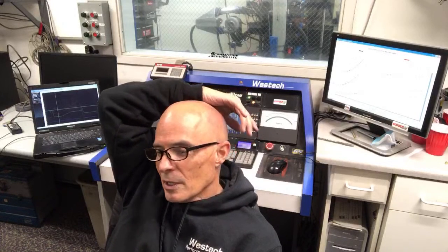What's the best place for water injection spot if there's no room for intercooler? Individually in each port would be the best way. I haven't plugged the PCV. I'm going to do that. I'll do that before we make any more boosted runs.